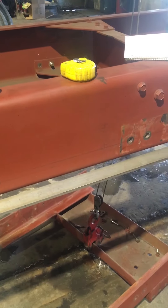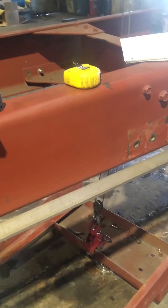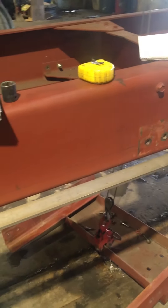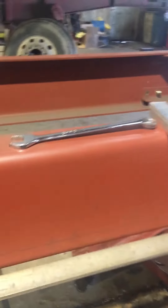Today I've got a pro tip, even though I'm far from being a pro. I've got a frame and a little bit of a blueprint, and I've got to basically turn this thing into Swiss cheese — fill it clear full of holes to bolt suspension and things like that on. I've got a lot of the holes marked, haven't center punched them yet, but I plan on drilling these with a mag drill and annular cutters.